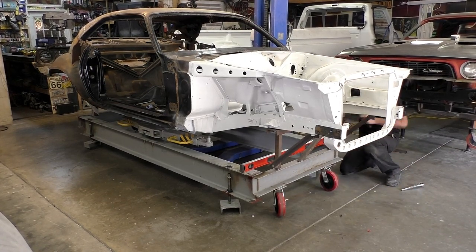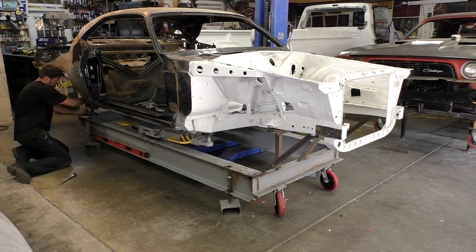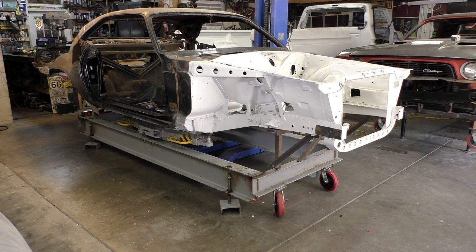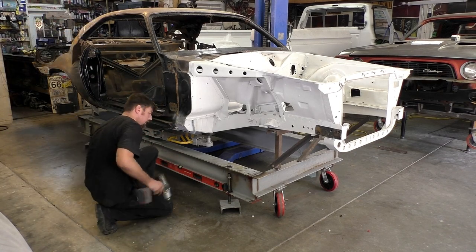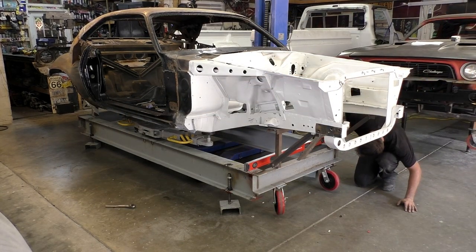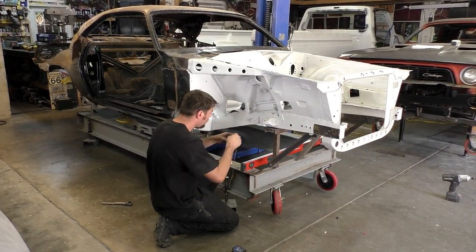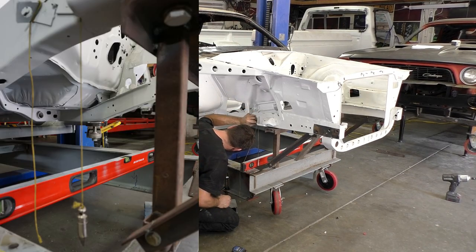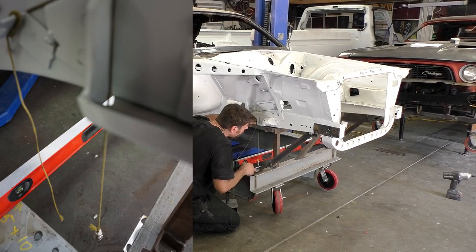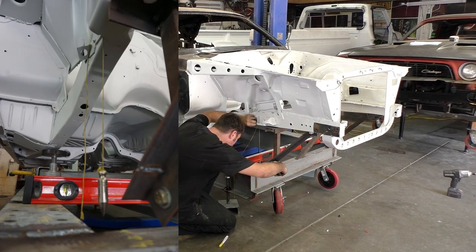Now I go around to the frame jig and I'm leveling out the frame jig on all four corners every which way - we want this frame jig to be level. When we drop the car, our mounts are the same length going to the same frame locations that are bolted in this car, so all those will be completely level. I'm bringing the frame jig up and lifting the front end of the car off the lift by just an eighth of an inch. Then we're going to go around to all four corners and drop a plumb bob - I picked the same frame measurements on both sides and this is just to get the frame jig squared under the car.